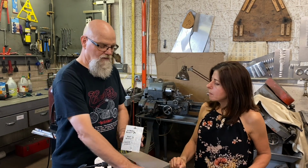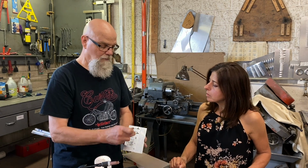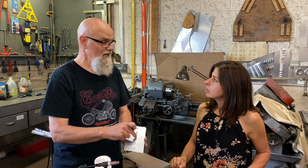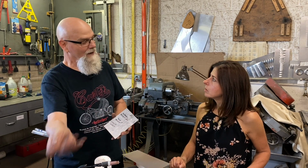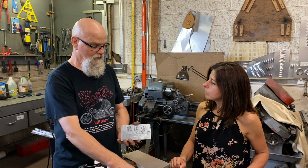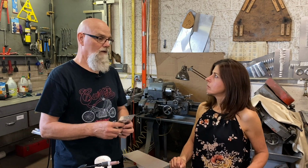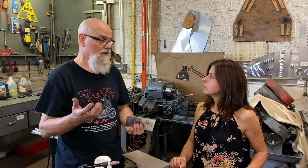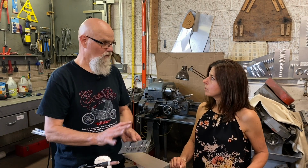But as you could see, the mandrel, when it's pulling on it, it's kind of like a nail. It's pulling the head of the nail into the tube of the rivet. That's what makes it expand without having a guy on the other side of it. Okay, so that's how they work. And they do really well. They're used in the marine world, in aircraft world, in automotive. They've even got plastic versions of that in the automotive world. So they're really wonderful fasteners.